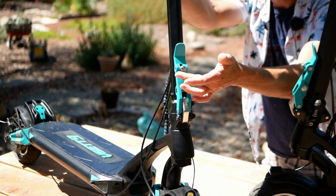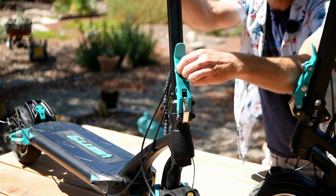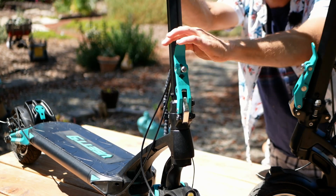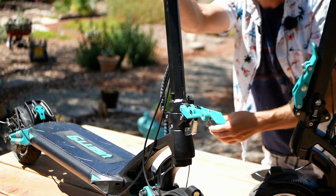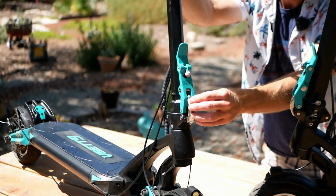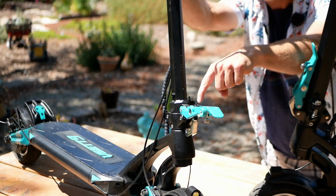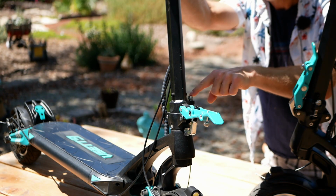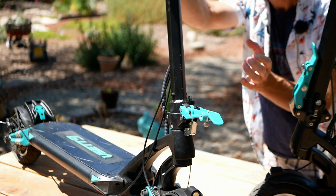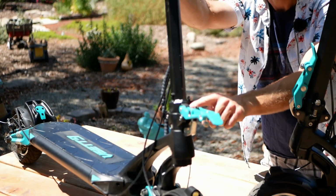First thing to do is you thread out this safety, this pin here, until it comes out completely. You can tell it's not screwed into the stem at all. Then you pop that one off. This is the thing that takes a little practice managing where this is. And like a lot of stuff on the Vsett, this hook is adjustable, everything is adjustable in here. So if you wanted, you could change it to apply more force to pop it into place, or less.